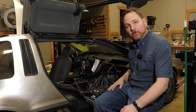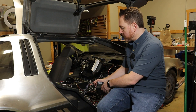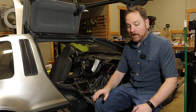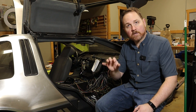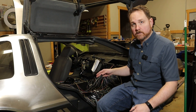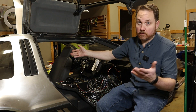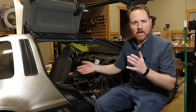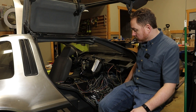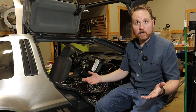What I have done is I've gone through and identified four modules that are in the car. Each one of them has dozens of wires going into them, and I've identified them because they are all on the same CAN bus. I'm going to take these and cut all of the wires and move them over behind the passenger seat. Previously behind the passenger seat were modules from the original DeLorean that handled the engine ECU. So I'm going to grab these four modules, confirm they'll fit over there, move them, and rewire everything.